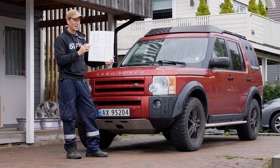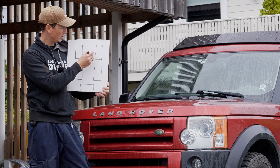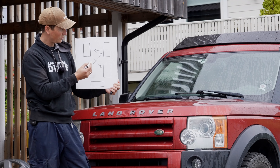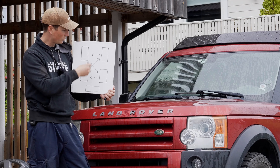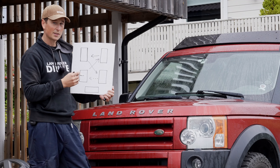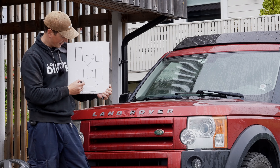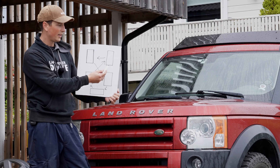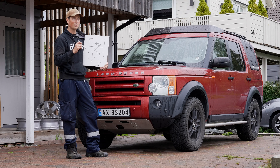This is what I think is the best way — it's not perfect with five tires, but you can optimize it. Basically: take the left rear and move it to the right front, right front goes to the left front, left front goes to the right rear. If you don't have a spare, it goes back to the left rear — you just cross over. If you have a spare, you incorporate it into that sequence. This way you switch from the left to the right side every rotation.